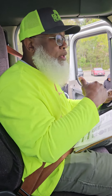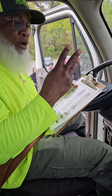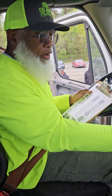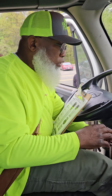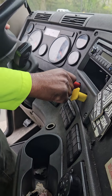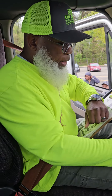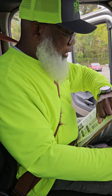The vehicle has reached the governor cutout rate. I'm going to put three fingers up — I'm going to turn the truck off, turn the key on, and push in the parking brake and trailer brake, starting now. Turn the truck off. Turn the key on so the dash lights up and push in the parking brake and trailer brake. Let the air settle. I'm going to hold the service brake down for one minute and the vehicle should not lose more than four PSI, starting now.